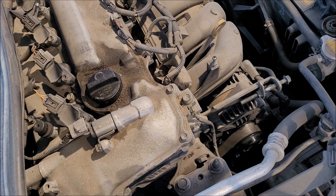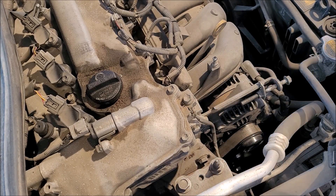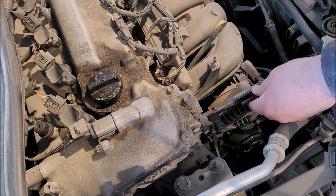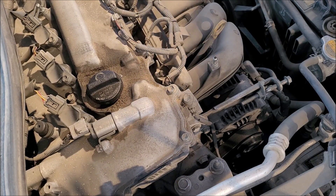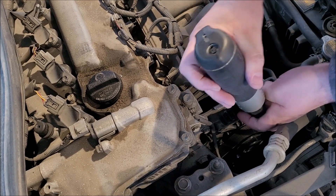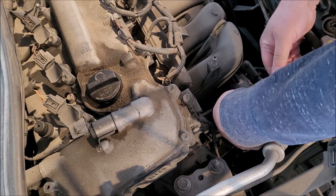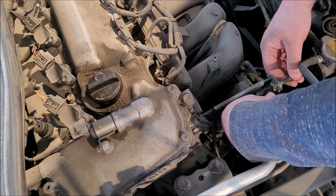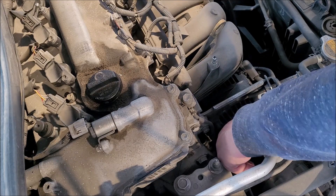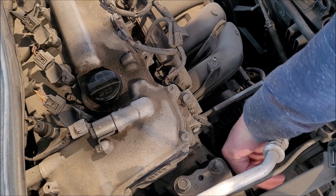So we'll pull this out. You can see it's clocked in like this — it's just one bolt right there that goes through the whole thing to pop it out. So once we loosen that, you'll notice this should slide. Now this little bolt right here, that's a 12mm.